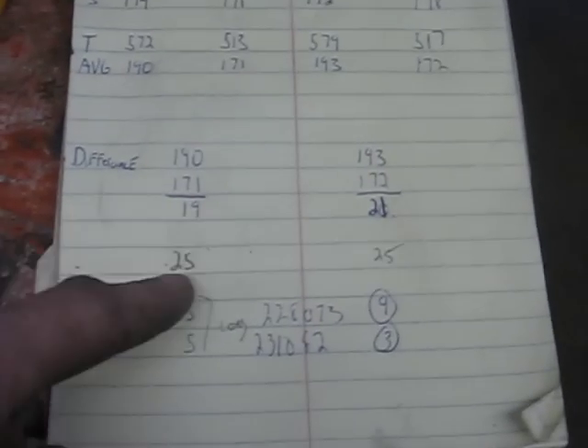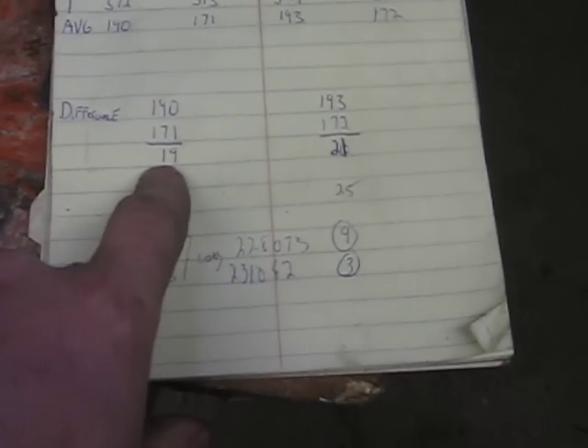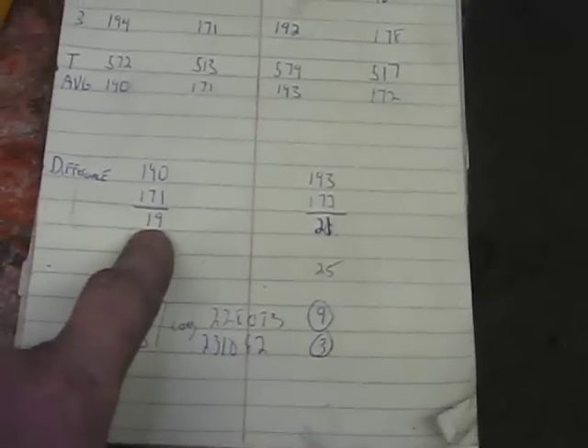Mine is 19 thousandths, so I need 25 thousandths worth of shimming. I need to take 25 thousandths out of the clutch pack shim stack, and then add 25 thousandths to the center stack. What's happening is I'm not squeezing it tight enough - in a high load application it would try and slip. If you're over 46 thousandths, it's just backwards. On the high range side I ended up with 21 thousandths, so I need the same 25 thousandths adjustment. As long as this number is between 42 and 46 thousandths, you're adjusted and good to go.